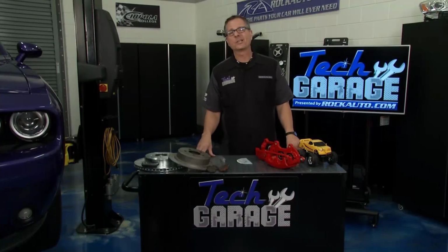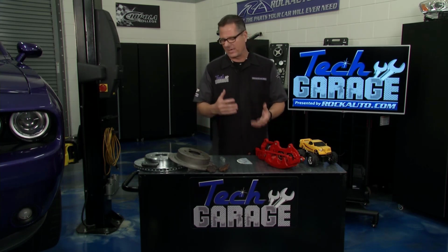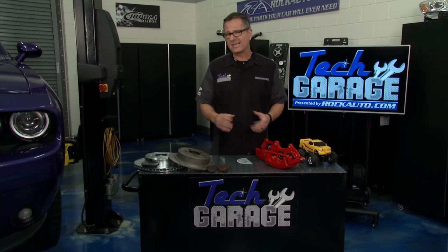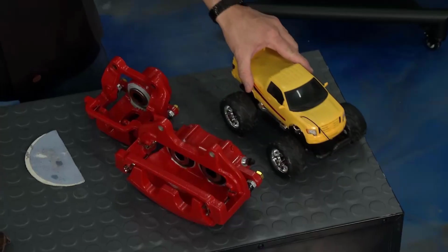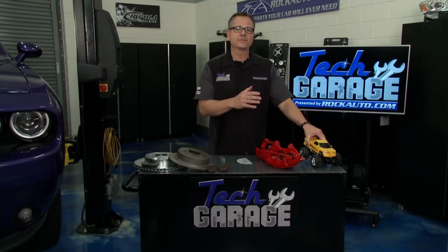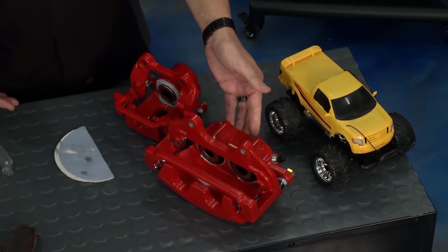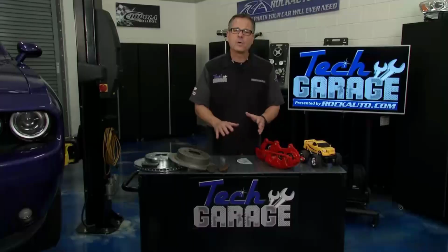Brian's absolutely right. Pretty paint don't equal performance. So what does? Well, we have to look at a couple of basic brake terms, and one of them is coefficient of friction and brake dynamics. Now, brake dynamics, that's pretty easy. I got my little model here. You're going down the road, you slam on the brakes, guess what? The weight keeps transferring forward. Most of the braking is going to be done in the front, hence our two calipers here from PowerStop. You see the two pistons in the front right there versus the one in the rear, so we're going to focus there.